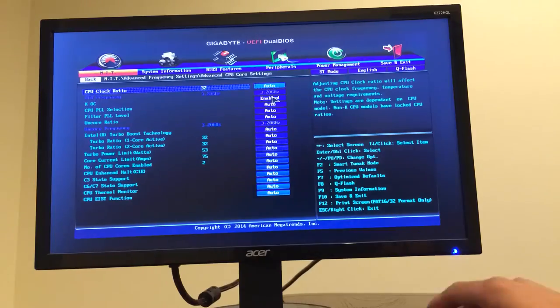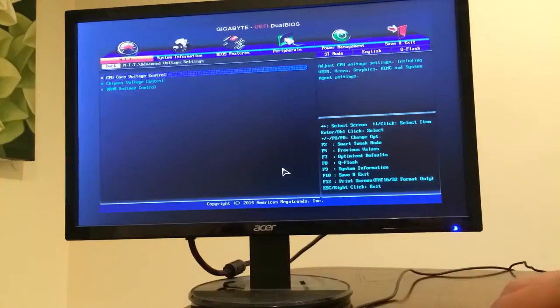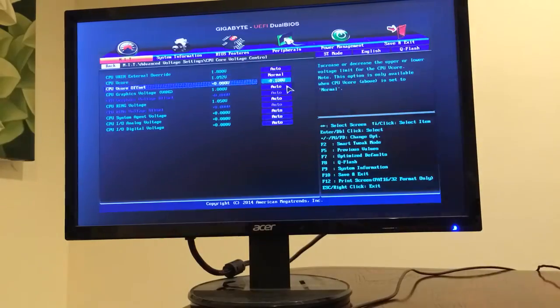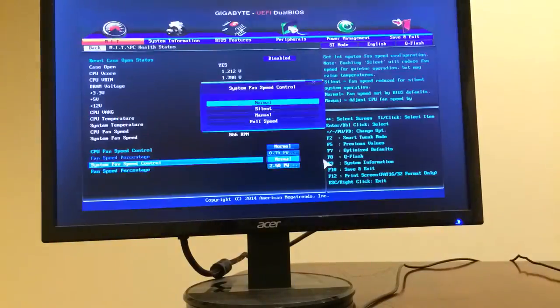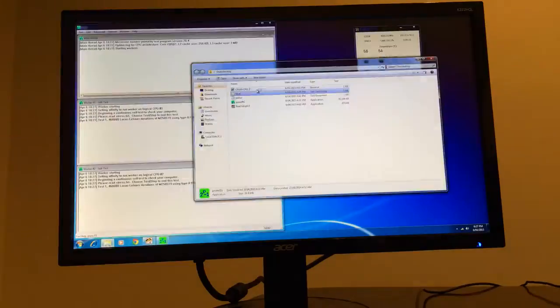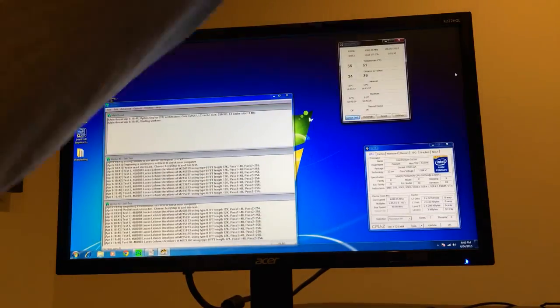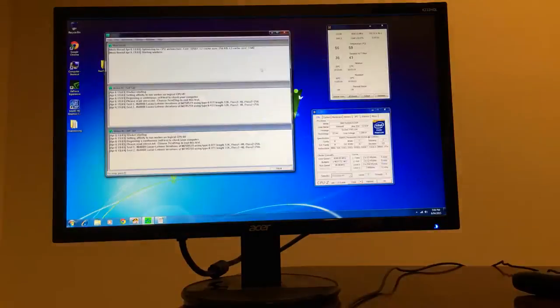Yeah. Okay, so the process took around like 8 hours, and yeah, I was really happy with the results because I got like 4.5 gigahertz in the end, and that I kept the voltage under 1.3 volts, so that's gonna run pretty solidly, I would say. And yeah, so you can just see here like how many times I benchmarked this.